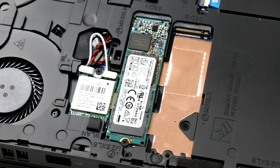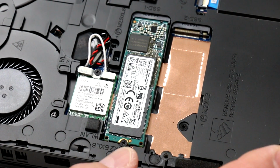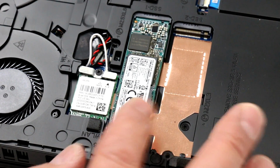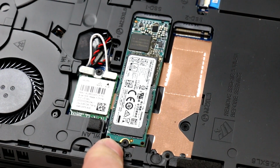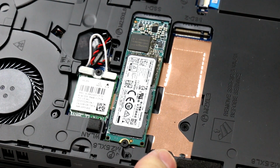And here we are spun around to the M2 slots, the solid state drive slots in this machine. Incidentally, it is a solid state drive affair only with the Alienware 13. It does not support standard 2.5-inch spinning media, but just these M2 sticks. So you've actually got two M2 slots here. The first one is populated. There's a second spare. So you can install up to a 1 terabyte M2 SSD here and a second 1 terabyte SSD secondary volume here.